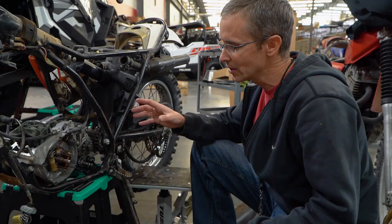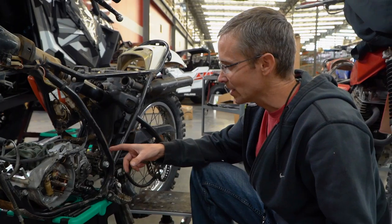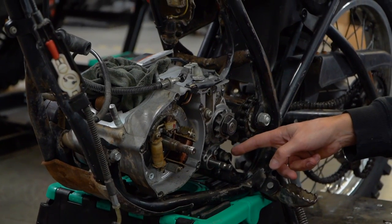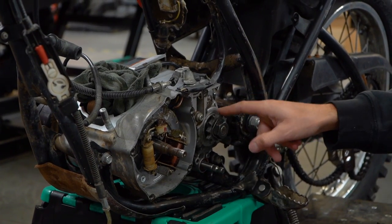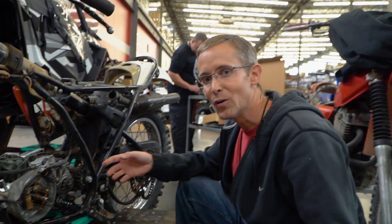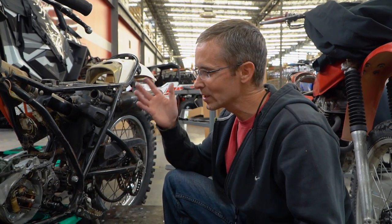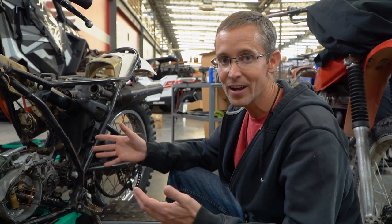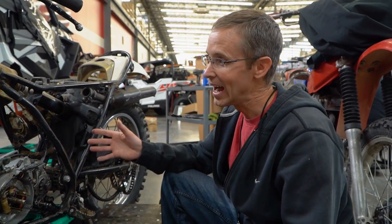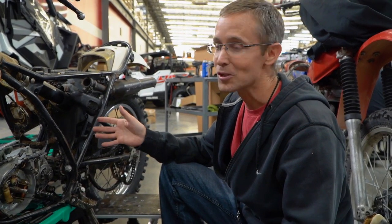I just gave you an update on my cylinder. I just want to tell you where I'm at with the rest of the bike. I replaced all the seals — the shaft seal had basically fallen out, so I put a new seal in there, put a new seal behind my sprocket on the countershaft, and there was a shoelace tied up in the old seal, so that's why it was leaking. No more leaks there. I've pretty much bought all my parts and I'm sitting at about $100 to spare.